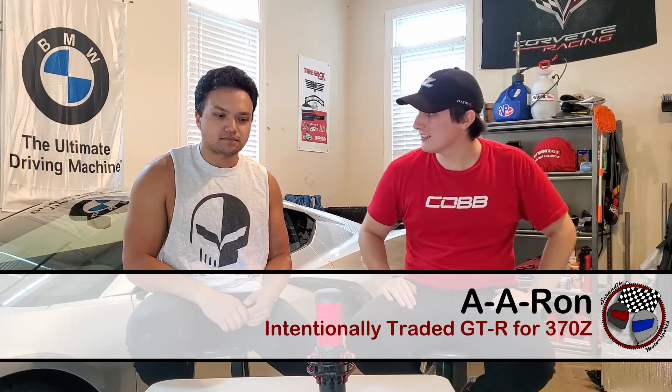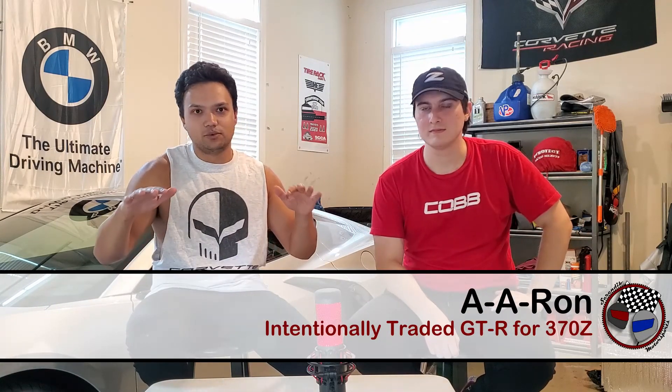Why are we doing this? So obviously you want the car low — lower center of gravity, quicker moment of inertia, all that jazz. But you also want relatively similar corner weights at each corner. In a perfect world, a car would be 50-50 corner balance — that means each corner has exactly the same amount of weight. That's not practical in the real world, so the best we can hope for is to get the cross weights lined up. If you want a full video on the science behind corner balancing, hit us in the comments below. Basically the point is: manage the weight, get it roughly even at all corners if you can, get the cross weights lined up, and your car will turn better.